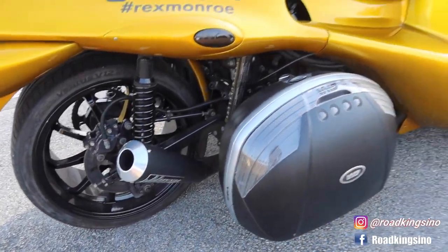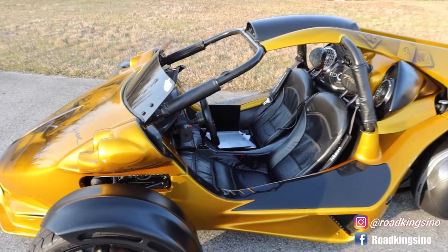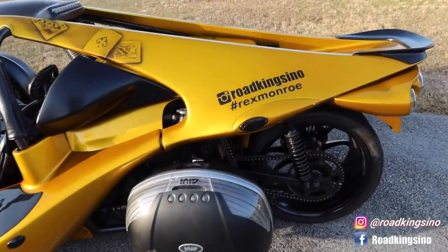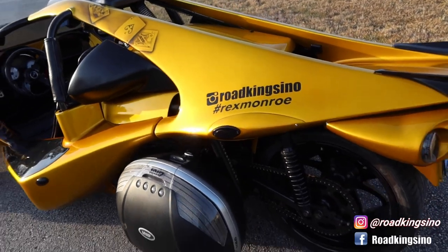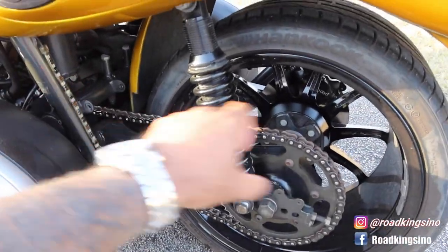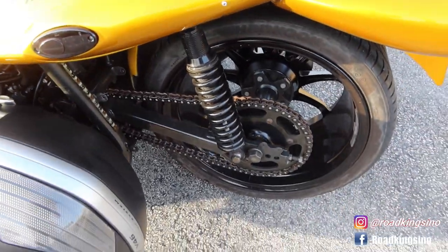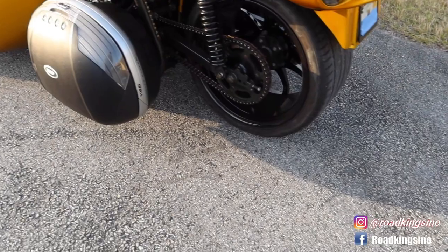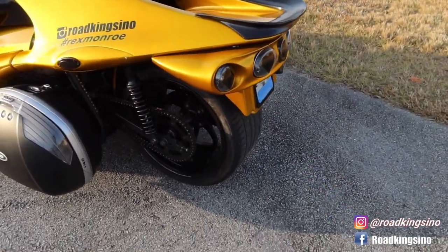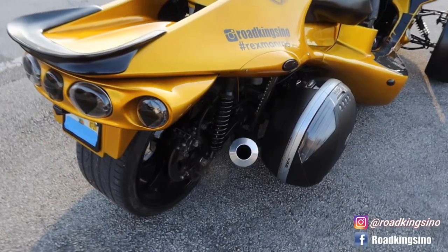I got to admit, I like it — I really like the way it sounds. I'm in the process of tuning it, so I'm riding around right now messing with some fuel adjustments to try and get her dialed in. But overall I like it. You all saw in the previous clip we saved close to 20 pounds — almost 19 pounds. The bars that came out holding the exhausts, those are pretty heavy. Their main purpose was pretty much just to hang those slip-ons, so I was able to remove those to save some more weight, as well as the full stock header with the slip-ons.